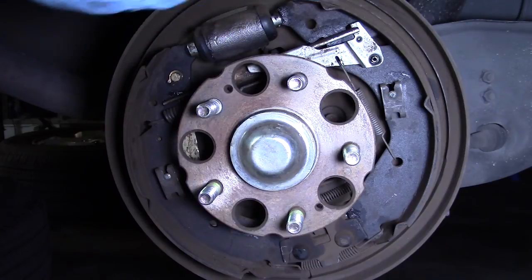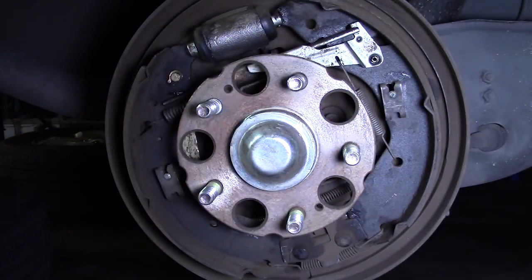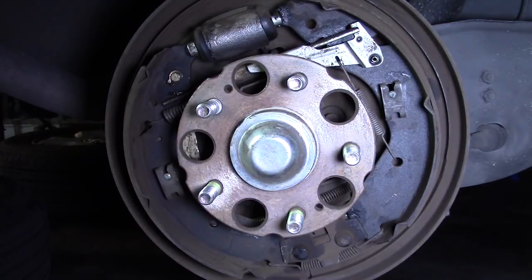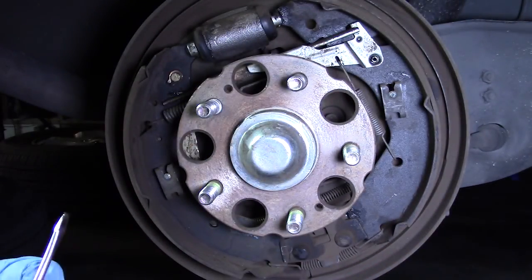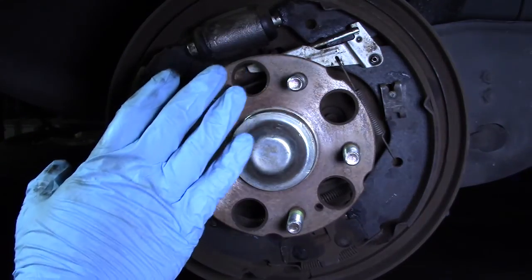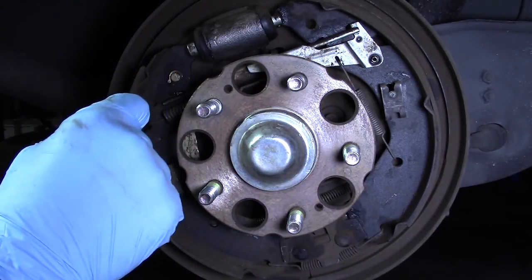Take a picture of all areas of the car — up here, down here, close-in pictures. Turn on your flash and make sure you force the flash so you can see every single component. Also, as we take things apart, I'm going to lay them down on the ground in the places where they were, so I can just go right back and pull the proper components and put them back on.